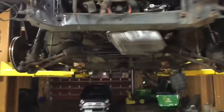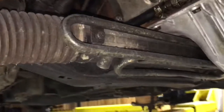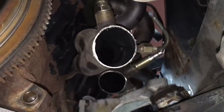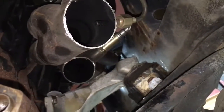The S54 is sitting in the engine bay and runs the same E28 535 or M5 motor mounts as you'd find in any other 24-valve swap. You can see there's still clearance for everything. This is a Z3 steering rack, same as the E36, which is why it's got this bigger cooler on it - you don't typically see that on an E30. Here you can see the fitment of the stock S54 headers cut off after the collectors. I'm going to be making downpipes for those and will show you what I'm doing as I go.